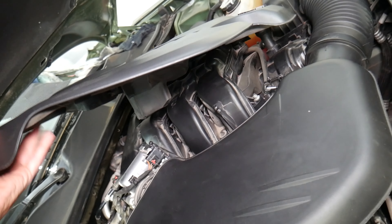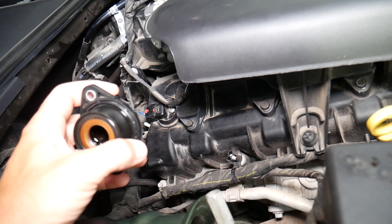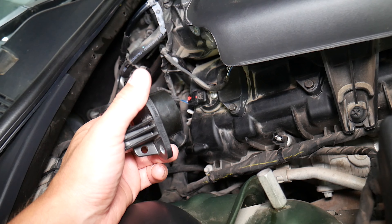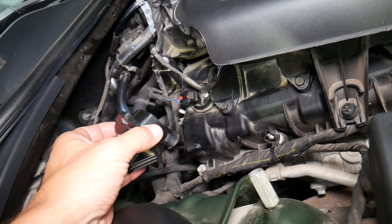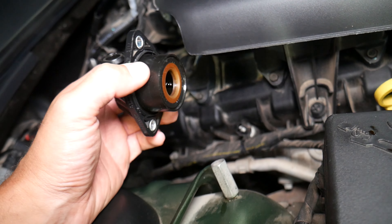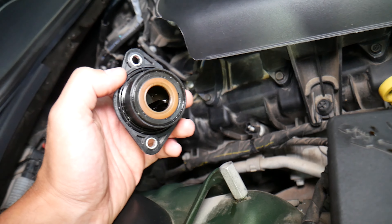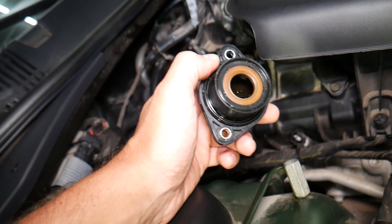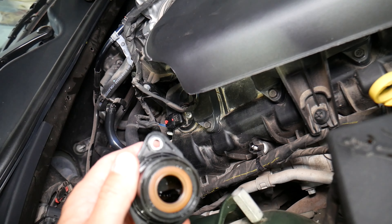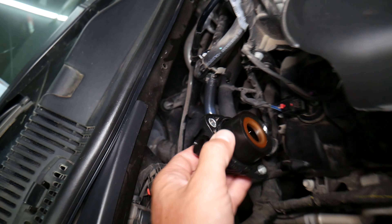What we have here is a device known as a PCV valve — Positive Crankcase Ventilation valve. This valve is super important. PCV valves are items you need to replace quite often, every so many thousand miles. They usually cost only a few dollars. If not replaced, it can cause that whitish buildup on the oil cap, increased oil consumption, multiple oil leaks, and can practically destroy your engine in the long run.